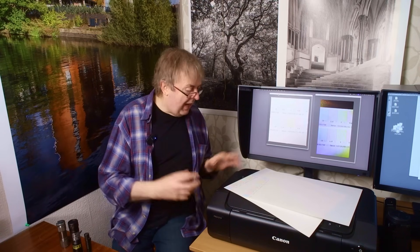I've just been doing some printing on the Epson P5000. That's been moved around when we moved house recently, and it's settled a lot. I always leave big printers to settle for a while if you move them. I hadn't used the matte black ink on it for a while — this is an older printer where you have to swap over inks. So I switched it to matte black, and of course I did a nozzle check, because sometimes that causes you might need to do a bit of a clean after that.